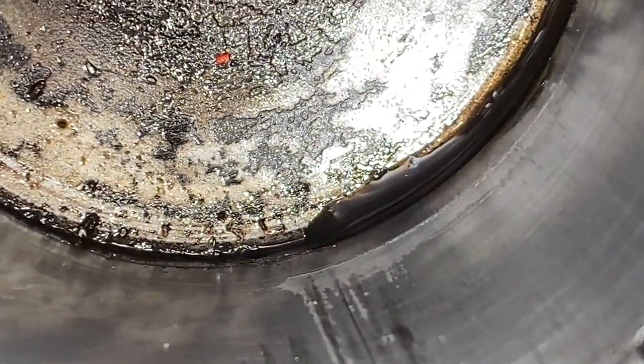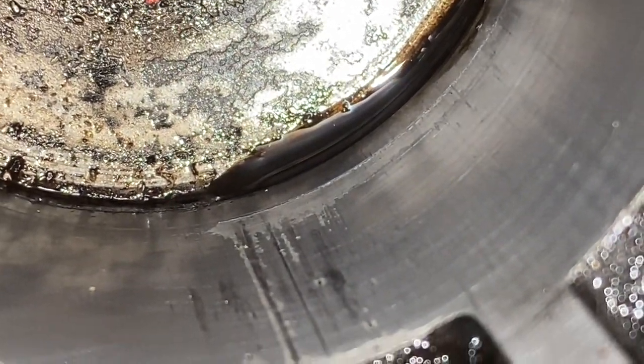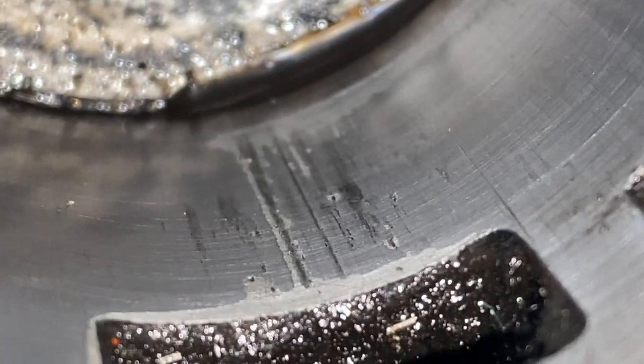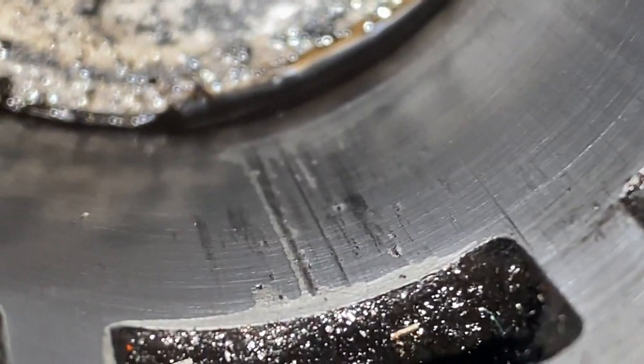During my cleaning process I discovered that cylinder is not good — the plating peeled right off, so I'm starting over with another cylinder. You can see where the plating is coming off: it changes color and turns kind of silver. That's the aluminum beneath the plating. You got to be careful with that. If the plating comes off, you've got to replace the cylinder.